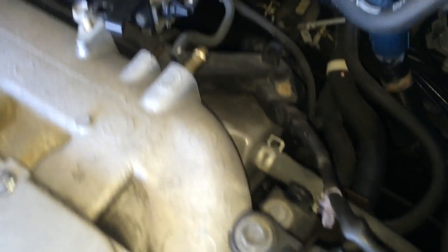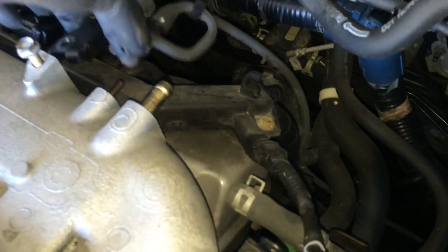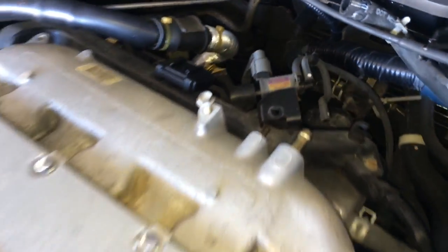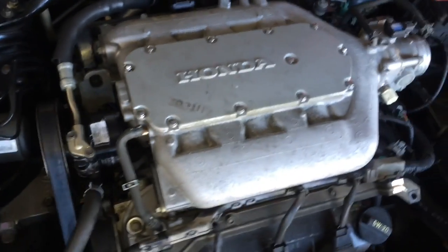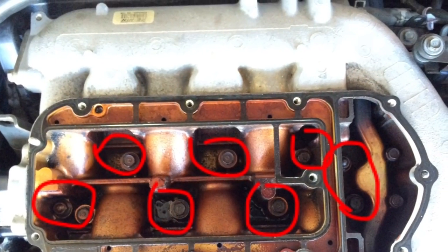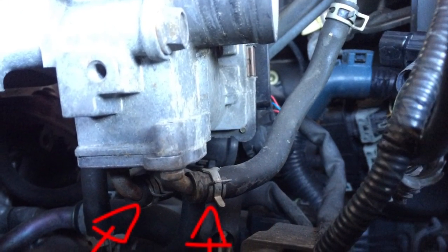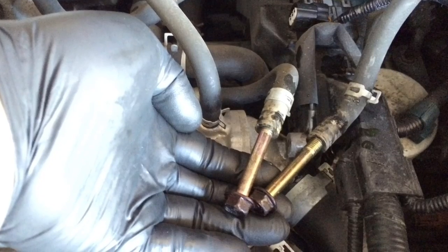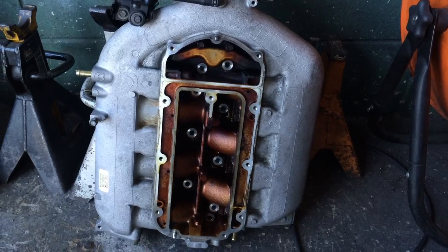Those clips for that plug. The brake booster hose — I believe this is the motor mount switch. In front you have the hose right here. Remove these 10 millimeter bolts, then remove these 12 millimeter bolts. These are the two cooling lines for the idle control valve — I plugged them up with the 12 millimeter bolts. After you have that done, lift off your intake manifold and set it aside.